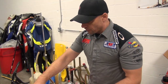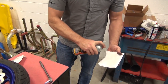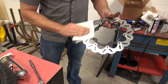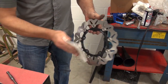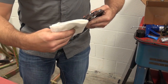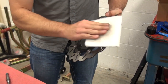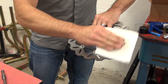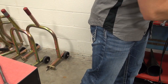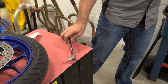The first thing we're going to do is get the Galfer rotor ready for installation. A little brake cleaner here. Oftentimes rotors will be coated in something to help preserve their finish and prevent corrosion during storage and transportation. So we'll just go ahead and wipe that off. Our Daytona Bike Week vacation seemed to eat up all of the shop towels, so I'm down to paper towels.